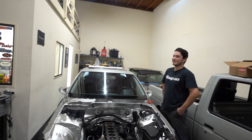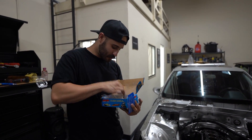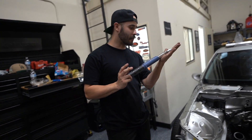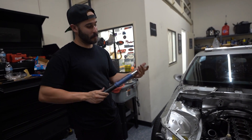We've got the instructions here. We've got the ARP lube and the washers with the studs. You're definitely going to want to use a torque wrench — you're not going to want to just guess on all this stuff. That's why we have a Snap-on torque wrench, about $400 and worth every penny. Make sure threads haven't been cross-threaded before. Clean up the threads, then use the ARP lubricant — it's better than motor oil. Run them through by hand only. Definitely follow ARP's recommended torque, do not go with the OEM spec, but you do want to go with the OEM sequence when torquing the head.